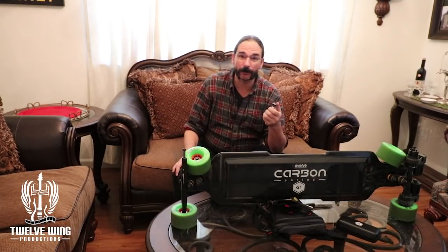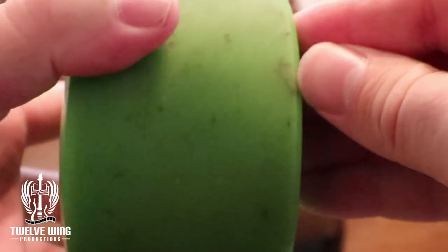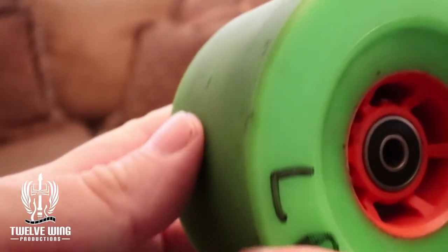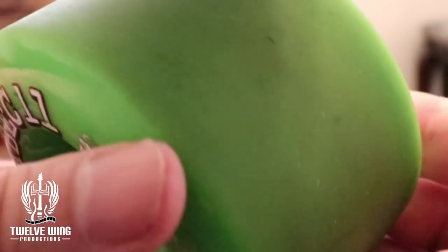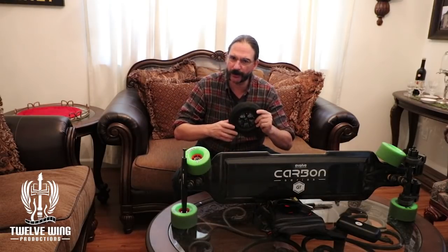You're all here because you want an engineer's take on it — well, engineers always want to know why. So let's start looking at why that might be. The first and obvious culprit is that those are the drive bearings — the wheels that are actually being driven. I've got a clip showing some of the damage done to the rear wheels as opposed to the front wheels, which look relatively unscathed. These wheels have about 240–250 miles on them, and the rears are markedly more worn. With AT tires, all of those forces are heavily magnified — the axle is a greater distance from the edge of the wheel, so there's a lot more force. When you hit a rock or when you're turning, the loads are probably tremendous.